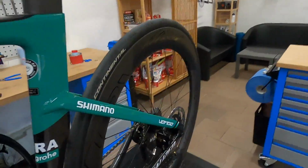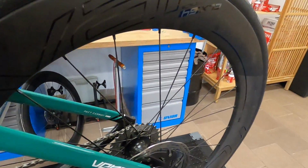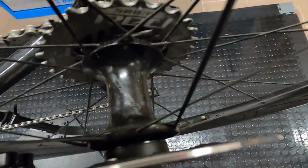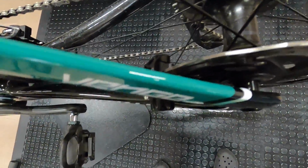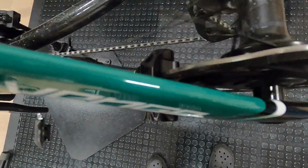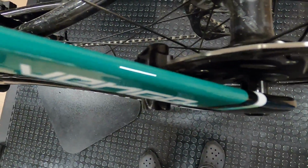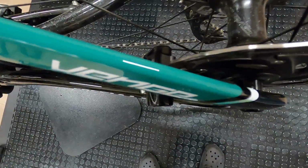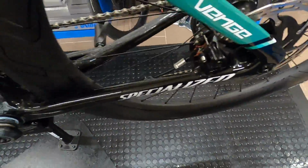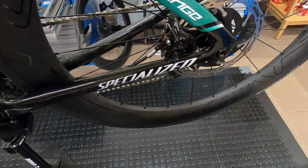So anyway, the main point we wanted to achieve, and Hope also advertises this in the product description, is that you get a lot more pad clearance than with other brakes. Well, unfortunately, I don't really find this to be the case. Pad clearance is sufficient, but I would say it's less than in a well-worn set of HRD calipers or the newer SRAM 2-piece calipers or the Shimano standard calipers. So on that front, we didn't gain anything, I would say.